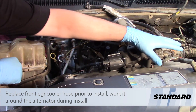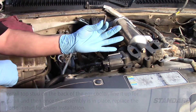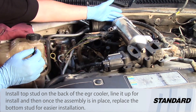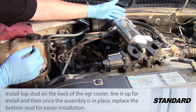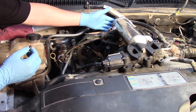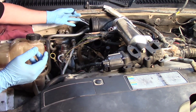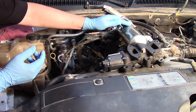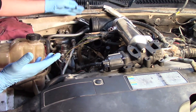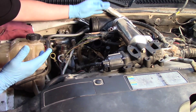Now we have our EGR valve mounted back to our EGR cooler along with our coolant hose and pipe — that's all mounted back on, which is gonna make for a much easier reinstallation. On the studs that were on the backside of the EGR cooler, the bottom stud is a little bit hard to reach with any type of socket or wrench. So what we're gonna do is we went ahead and replaced only the top stud, so we can mount our gasket on once we get this in place towards the back and get it flush with the exhaust — then we can reapply the bottom stud from the backside.